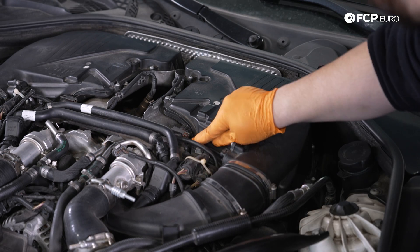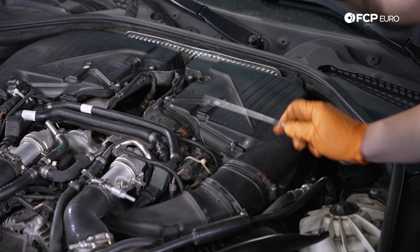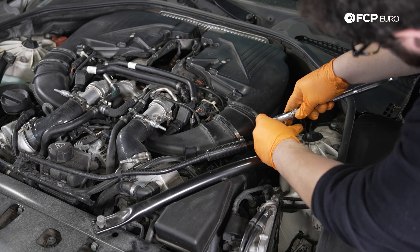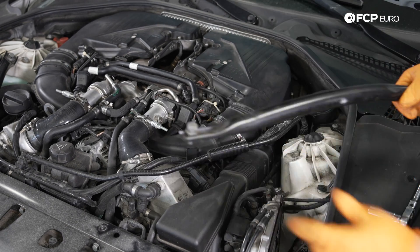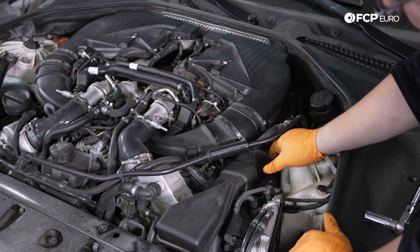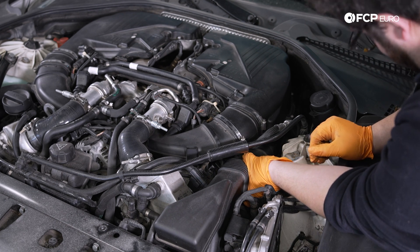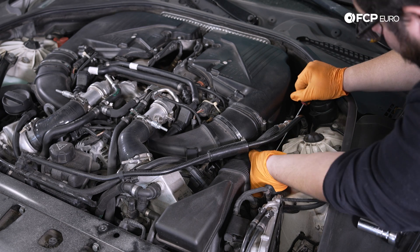From there we're going to free up this clip — just a little metal locking clip. You pull it towards you, it lifts open. From there we need to remove these two 16mm bolts for the crossbar that goes from the radiator support to the strut tower. I'm using a 16mm socket on a 3/8 ratchet, and then we have this intake tube which connects to the box up here. These can separate right here — you may pull it out as one or split it.